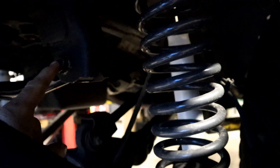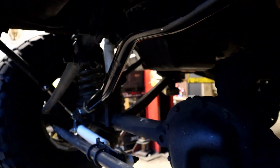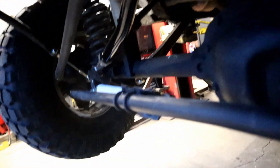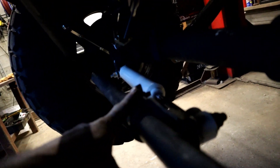A lot of times the mount and the lower mount get kind of wobbly and hard to move, so a lot of people try to put bigger bolts in there to fix it. I would say just replace the track bar. That's the first thing I do — replace the track bar. This one was $130 and it is super beefy.